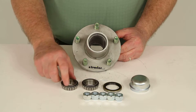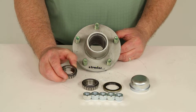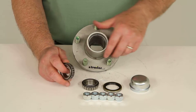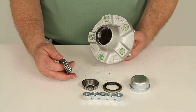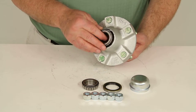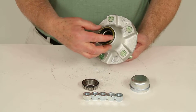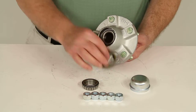The inner and outer bearings are actually the same size and same part number: L44649, which is stamped on the bearing. For the inner bearing, you'll see the race is already installed. Go ahead and grease it, then drop it into place onto the race. Then take your double lip grease seal and tap it into place so it holds everything there.